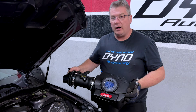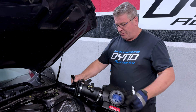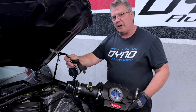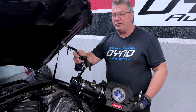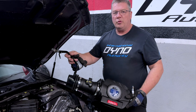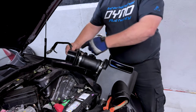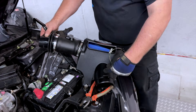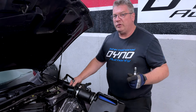Overall this is a pretty good design. They reused some of the hardware that came with the stock air box — rather than reinventing the system, you just pop some of the hardware out. You're going to reuse your mass air flow sensor. On a lot of these V6 Hondas from 2013 to 2017, they get rid of the pipe altogether and replace it with two hoses. On this one, they actually utilize the stock pipe that's already made and already bent for the car. This gives a nicer straight shot, gets rid of half of the wrinkling in the intake, better intake flow, a straighter run to the box, and then a high flow air filter. Does that make any difference in horsepower without a tune? We're about to find out.